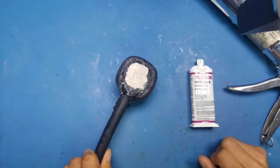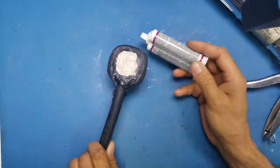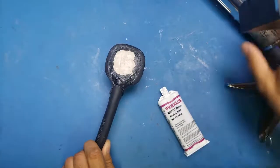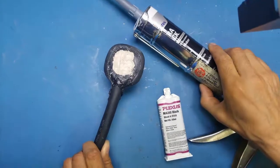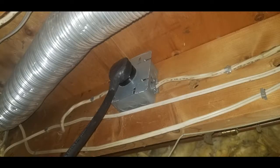On the other end with the four prongs, I needed to replace all the plastic that I had removed from around them so it could fill in the space and insulate the wires. I first filled in 80 percent of the space with fiberglass filler, as it would not be cheap to use that much good quality epoxy instead. I then topped off the plug with professional epoxy to properly seal everything, and used a thin layer of liquid rubber for texture and to provide some grip.